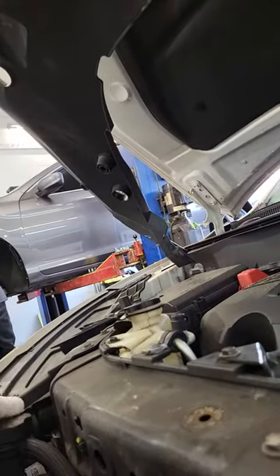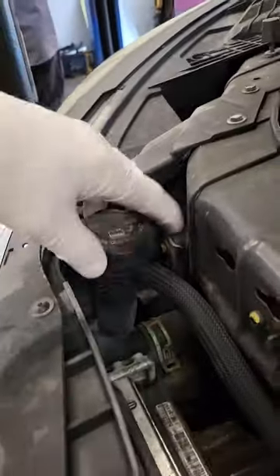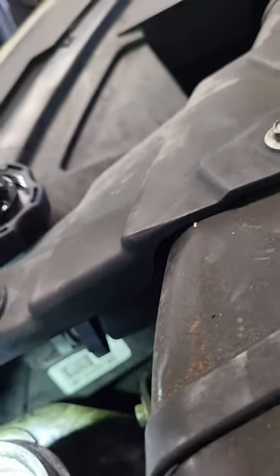Let's get the radiator cap off. This is not a true picture of what's going on in your cooling system — you need to access the radiator cap and see what's up. And wowzers. So we have extremely low coolant if you can see that. There is probably half a gallon worth of coolant missing, and it didn't show up on my visual inspection, which concerns me, because typically orange or red or blue or green is very obvious to see on a cooling system.